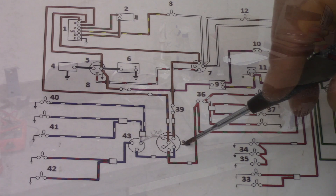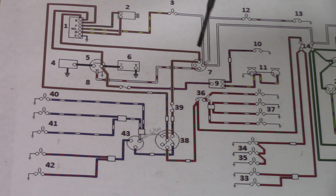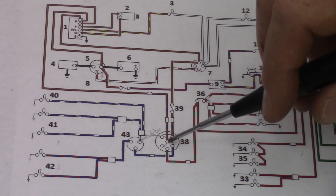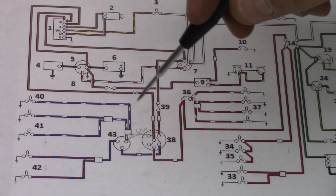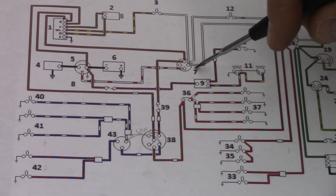This number 38 is the switch in the steering column. Number 43 is the main beam switch down in the footwell. The British cars are wired a little differently, but this is the American version. Essentially you have this wire coming in as the main feed — if you trace that back it goes all the way up to the control box, so that's main power from the battery feeding right into the switch via a heavy brown wire with a blue tracer.